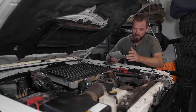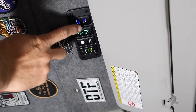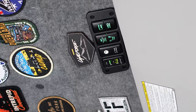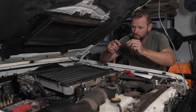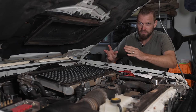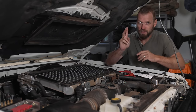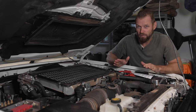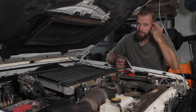Also as part of tip one: with your wiring diagram, make sure you understand it. When you match up the switch the wire colours are going to be different, so write down — for instance blue to yellow, yellow to yellow — those kinds of things. When you're installing two lights, or especially front lights that have two lights in one with a double switch, it gets a little complicated. If you write down where each wire goes you don't have to try to remember it.